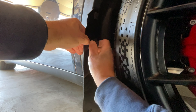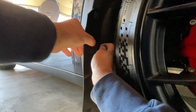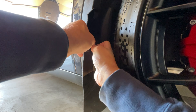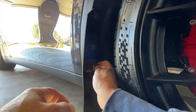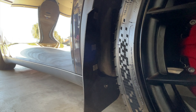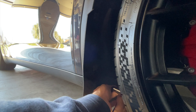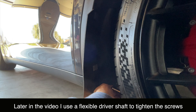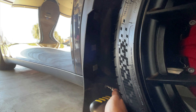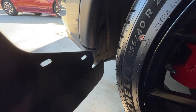I missed one — the back clip didn't land on the plastic — so I had to carefully take it out. It's definitely hard to get out. Make sure you push it back behind the plastic trim. Okay, that one grabbed. The mud flap is level at the bottom, so now I just go in with the right-angle screwdriver and tighten those screws. This one is done.